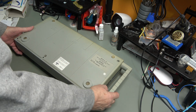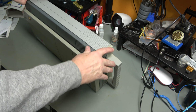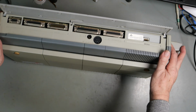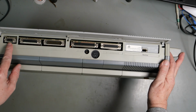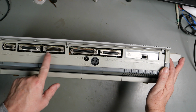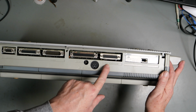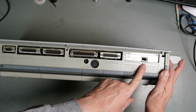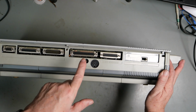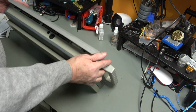BT approval number. So I guess this looks like a flap, so we can pull that out, and we have video. Looks like CGA or possibly monochrome. Parallel serial something, expansion AB, phone socket. I guess that's for an Amstrad monitor. Don't have one of those. DC in. I read on the bottom DC input voltage is 12 volts.